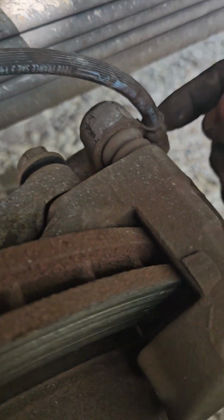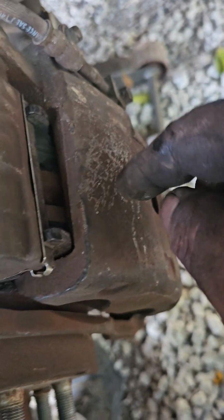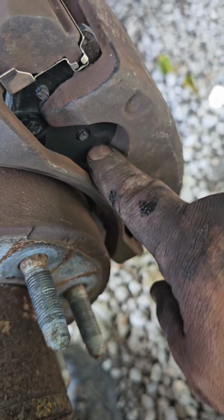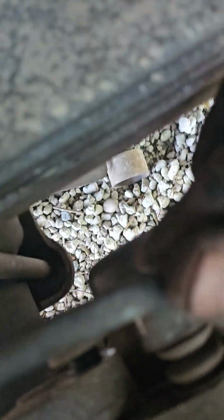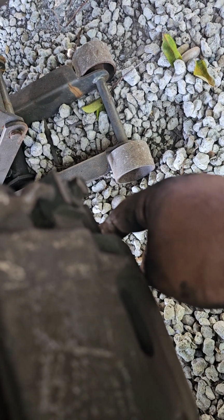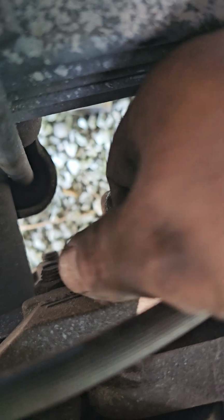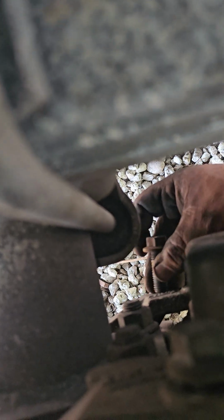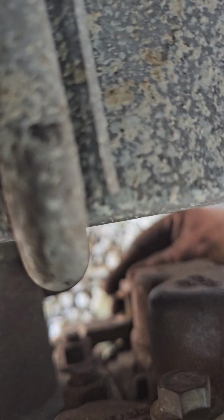All right, so we got the brakes inside. The brake pads are inside, as you can see. New ones are in, so you can see the new ones and the old ones. And we tighten up the T55, which is this one right here. The other one slipped in, like I said, because it was actually there. It didn't come off. Now we put in the 18 millimeter bolts, one on top and one on the bottom. If I can see it. Well, here we go. Sorry about that.